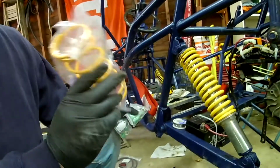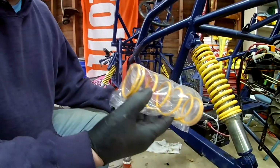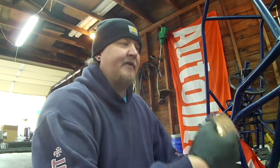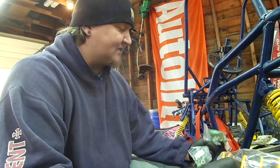The other nice thing is with this spring, it's kind of like putting a stall in a normal transmission. Nothing's basically going to happen until about 1500 RPM, which is also nice because we almost couldn't get this thing to idle low enough to not have it creep forward. So now we'll be able to keep the idle at a decent range. The thing's not going to sit there and try pulling itself forward. So I'm excited about that. But let's get this torn apart, get everything in pieces, and have a look at it then.